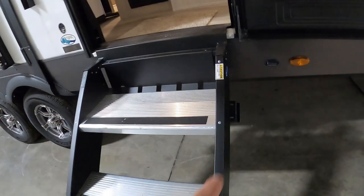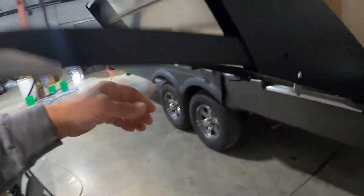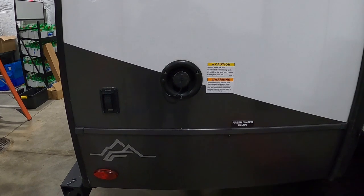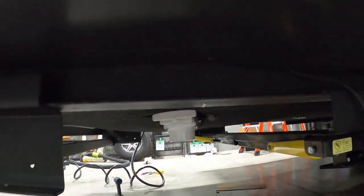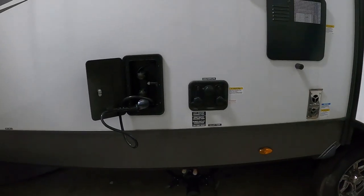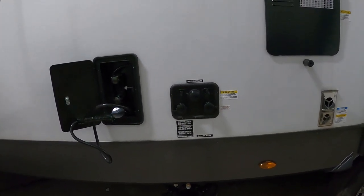For the steps, make sure your exterior door is all the way open, otherwise this piece will catch on it going up. The feet are also adjustable by flipping up on these — move it up and down where you need it. Before leaving, lock and deadbolt your exterior door — lift and turn this handle and you're all set for travel. If dry camping, bring up your stabilizing jacks, come back to the fresh water drain, open that up and dump the fresh water, hook up your hitch, and head to the nearest dump station or home. If at a campsite, unhook your water, cable, and power, bring up your stabilizing jacks, and head to the dump station.